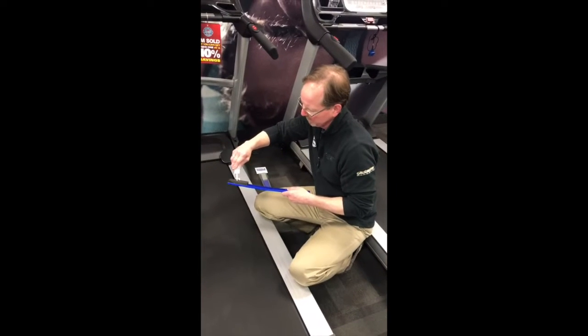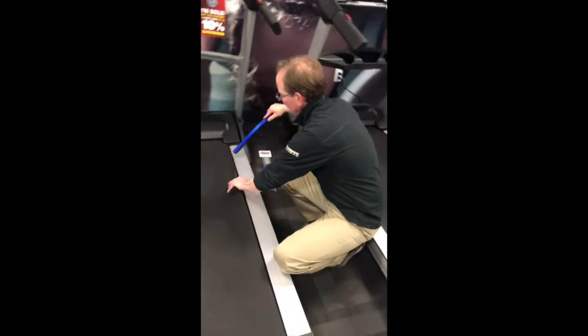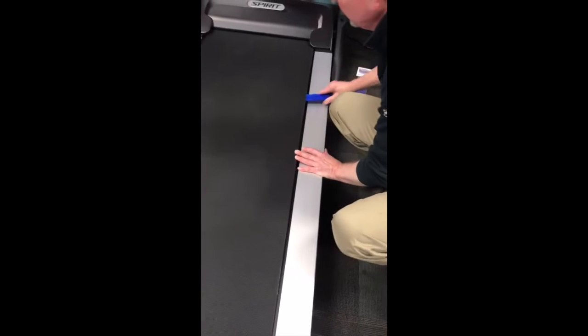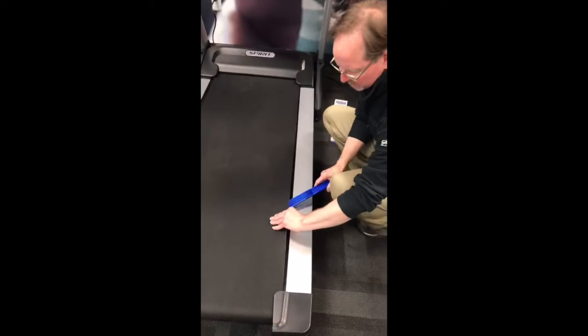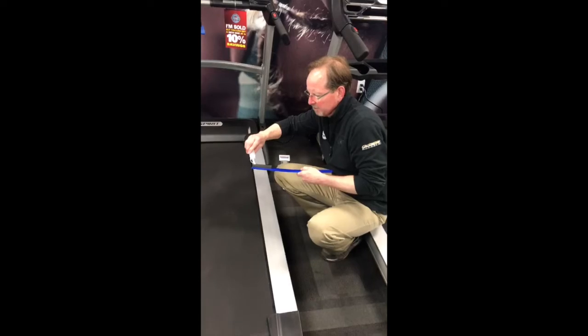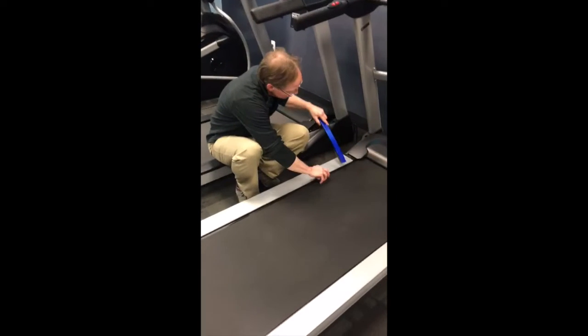All you do is take your kit, take your lube, and saturate the sponge — just one nice bead of lubrication. Then lift up on the side of the belt and slide your stick back and forth in a nice big lazy W, covering about the first two-thirds of the belt. Pull that out, re-saturate your sponge, and then do the same thing from the other side.